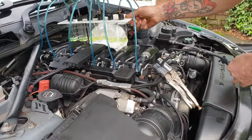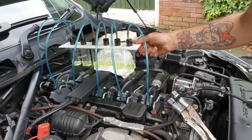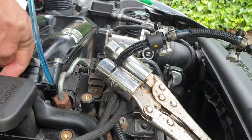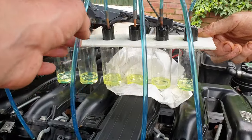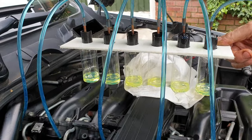Anyone doing this, remember to clamp off your return hose, otherwise it'll piss diesel everywhere. To remove these clips, you pull the gray clip up, pry it up from the bottom, lift them up, and then the whole line just comes off. I've got another video showing how I made that from pound shop stuff.